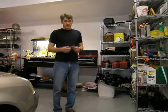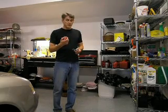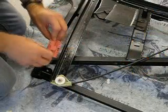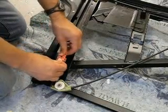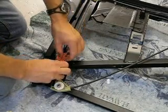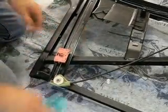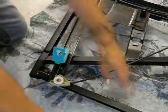Well, I went to the Audi dealer today and picked up the new part for $6.18. It's more durable, it's heavier, it's been redesigned. So I'll go ahead and put this one back on the slider and reassemble the door. This part slides on to the rail. Pull it over about halfway, snap in the wire, and then this device goes back so that the window can mount on there.